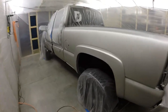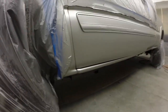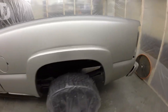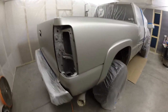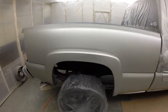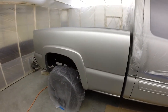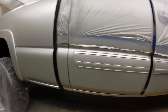We got the base coat shot. This is just the base, no clear coat yet. It came out really clean and nice. Looks like it's going to match well. Definitely pleased with the color match — the Shop Line paint goes down great. Silver is definitely a hard color to spray. You got to make sure you really dust it on. You cannot do close quarter sprays with it or you will see the tiger stripes in it. Anybody that's sprayed silver knows how easy it is to do that. This is just the base coat — I still got to do the clear coat next.